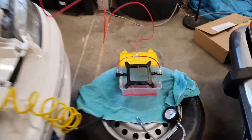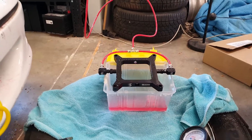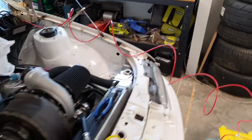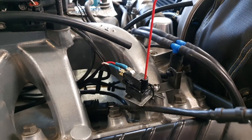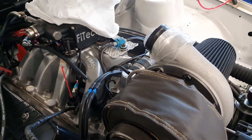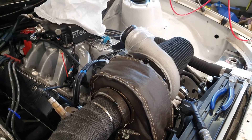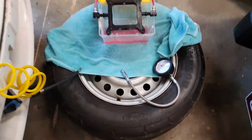I'm back to install the water methanol nozzle plate. I've just tested the system and it does work, but what I want to do now is set my Hobbs boost pressure switch to come on at 5 psi. I want to do that because I'm aiming to run around 9 psi for the initial tune, so I wanted it to come on just over half of maximum boost.